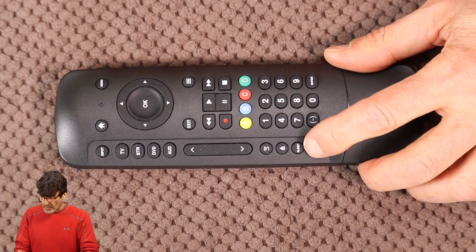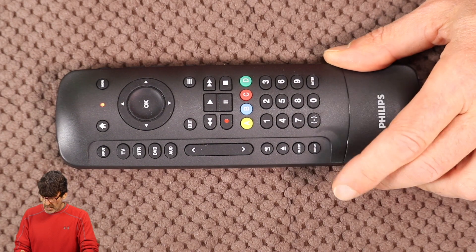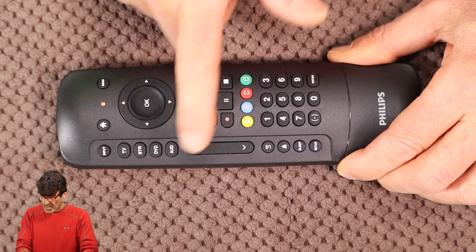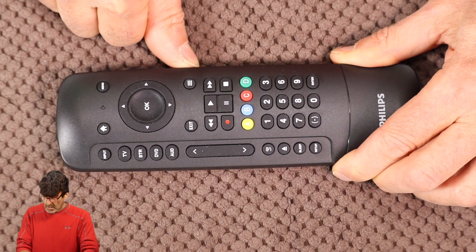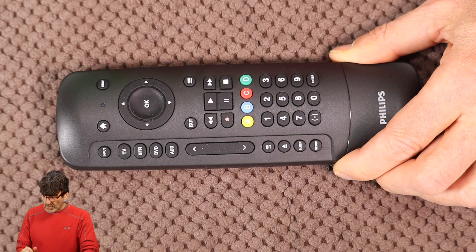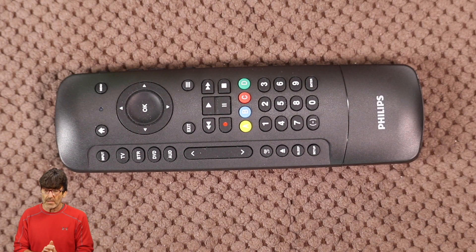To disable this and go back to your TV volume, press setup, then audio again to disable it, then mute, and now press volume down this time. You'll see it flash twice and shut off. That's it — the TV volume is back to the way it normally works.